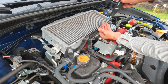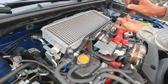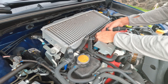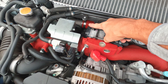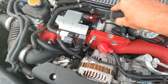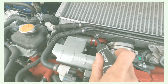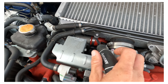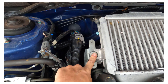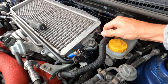There's that gasket. Next we're gonna be loosening these hose clamps right here. A simple flathead will do — you could use an 8 millimeter socket but I find the flathead a little more efficient. We're gonna leave those on, not take them all the way off — just slide those down. We'll also loosen the Y pipe coming off the intercooler going to the turbo. Just one more and then we can pop this intercooler off — again, we just want to loosen it, not take it all the way off.